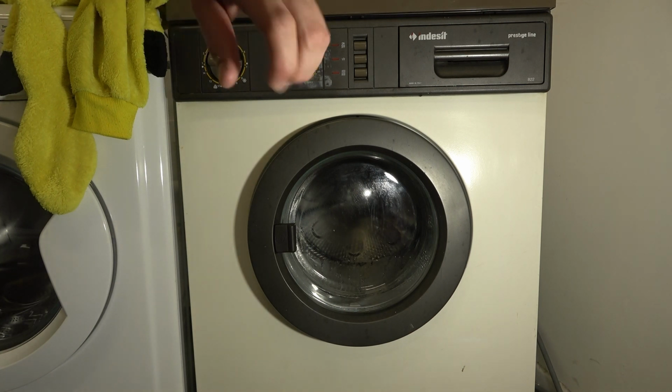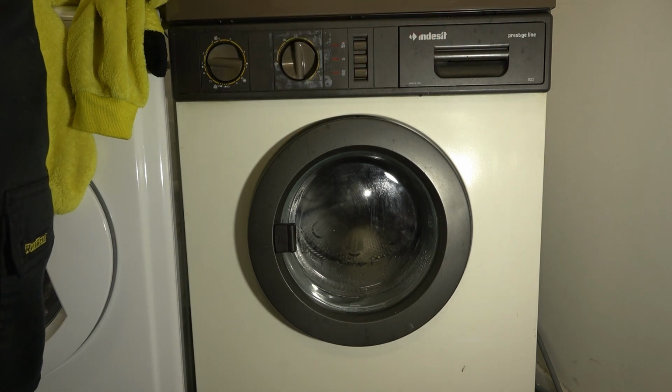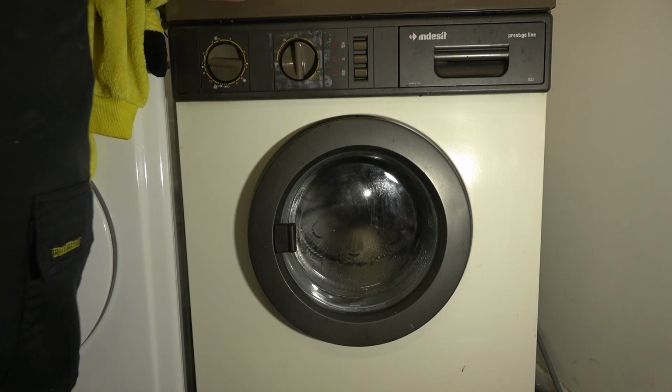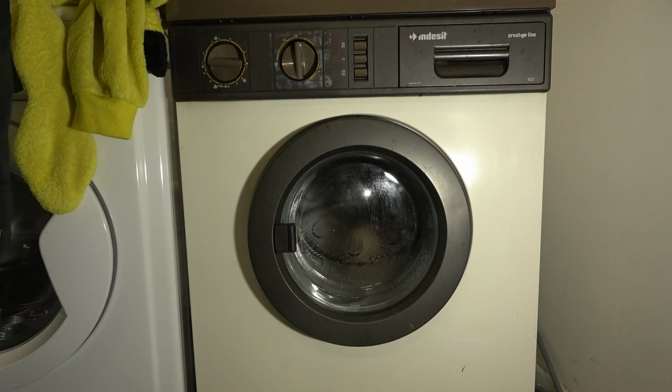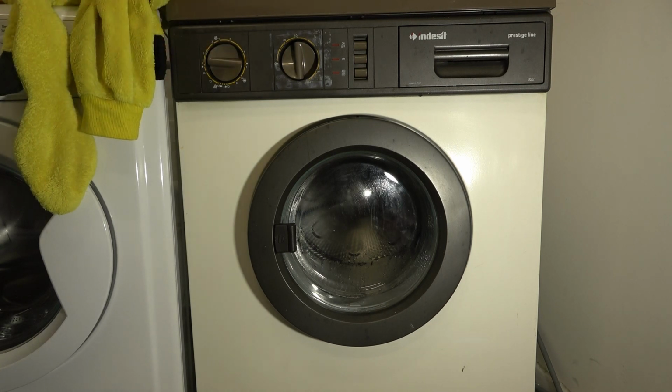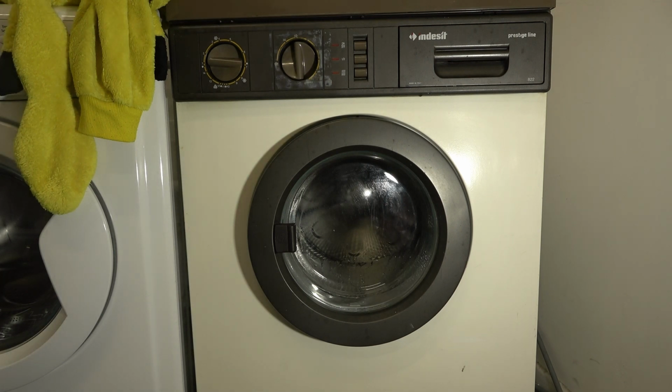You've got the little diverter that connects to the timer. And normally, on any machine that has this diverter, when you're going round there is actually a bit of resistance before that diverter changes, i.e. if it's going towards the pre-wash or the main wash or the fabric softener. However, there isn't on this. So even if you want to select pre-wash, it's hard to get it directly on, because there is no resistance on that diverter.